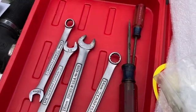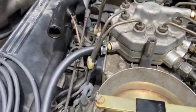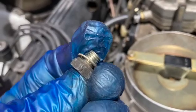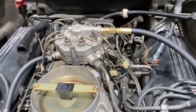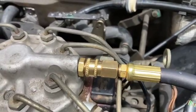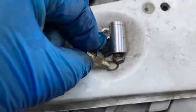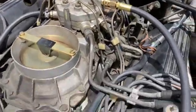In a moment I go over the installation right there at the fuel distributor. Here is the one port you need to connect to — that's plugged typically with a crush ring. Make sure that that is in good shape, otherwise replace it. And up here, that's the cold start fuel injection port that you need to tap into with the connector. That's the fitting that goes into it, and that's the aluminum crush ring. Make sure that is in good shape.